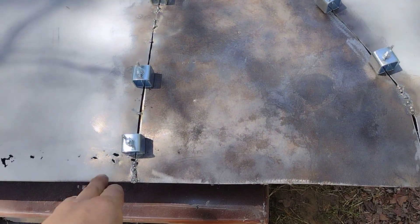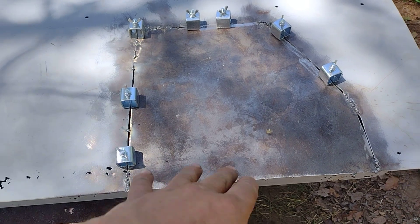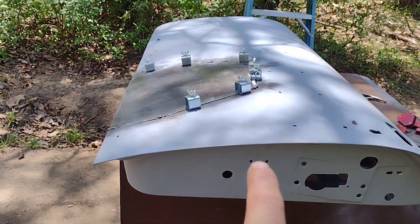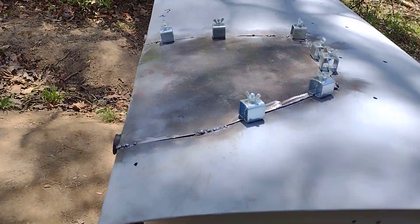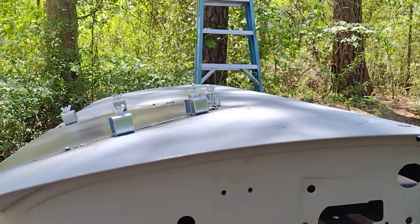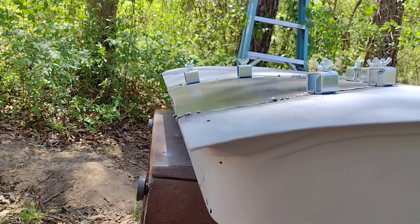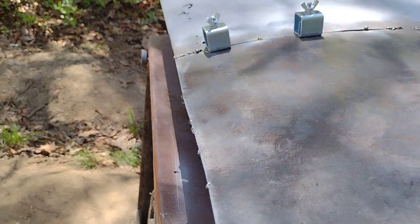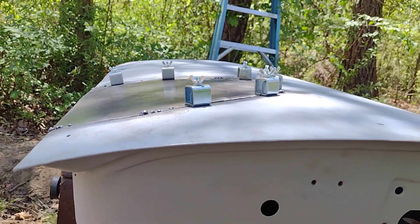I used these to pull this thing together and get it really nice. I did create the body line in it because this door has a curve to it — it's not flat, so you got to keep that in mind. There's a little curve right there on that door skin. It follows the contour of the door, the edge might be a little bit high right there, but I think we can get that out — might be able to take a file and just run it to straighten it out.